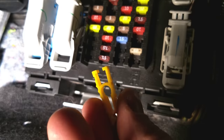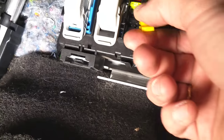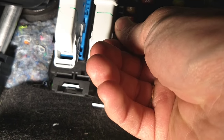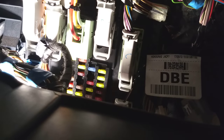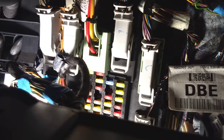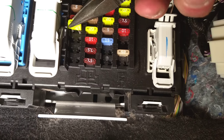I'm going to use the fuse puller that came with our replacement fuses — check the description of the video below for tools and parts at an amazing price. I'll grab fuse 61 from the top. It's very limited room in there, so because I'm trying to hold the camera with one hand, I'll just go ahead and grab it with the pliers to pull it out.